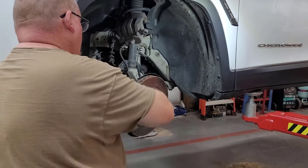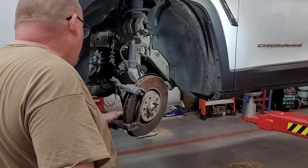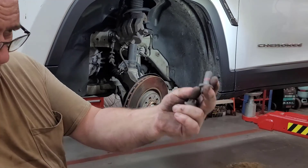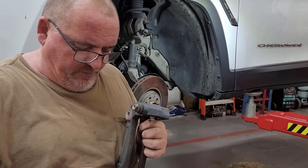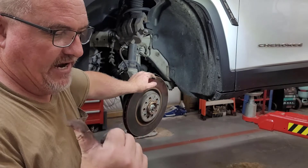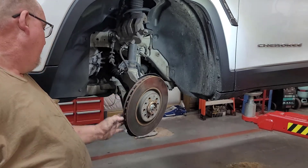Something I do — I shouldn't use impact, but that's okay. To give you a better idea how long this takes: I don't know that I've got this year model Cherokee on the channel, so I decided to add another brake video. That pink right there tells you it was factory. I'm going to yank the hardware off and clean it, and make sure these pins get a little re-lubrication — they're stuck pretty bad.